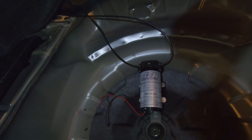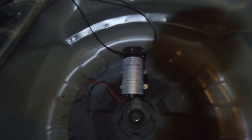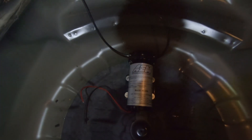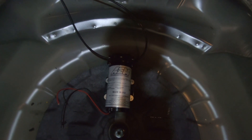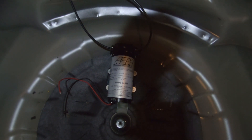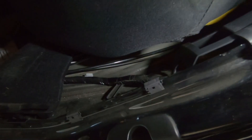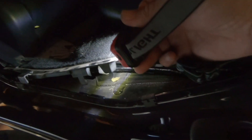The kit comes with basically a 200 PSI pump — it's pretty reliable. I have it currently bolted down to the floor. I drilled through and used nylock nuts on the other side. It's been pretty good at keeping the thing stable. It has rubber feet and rubber isolators from the kit, so you can see it's going to hold its own against vibrations. The meth lines go in and then they're run through — let's go ahead and cover where those go.